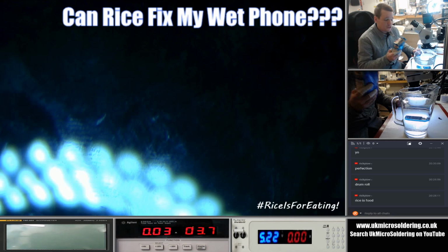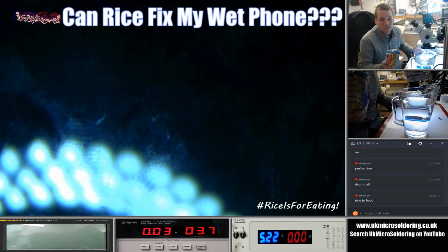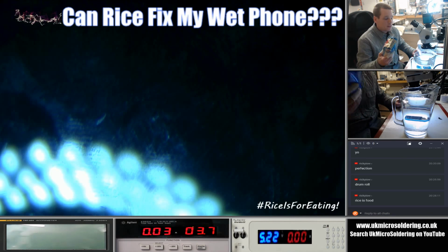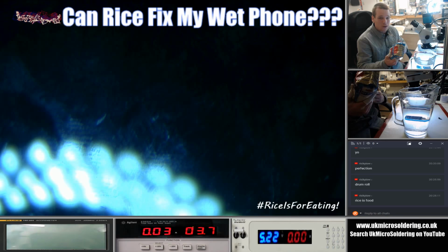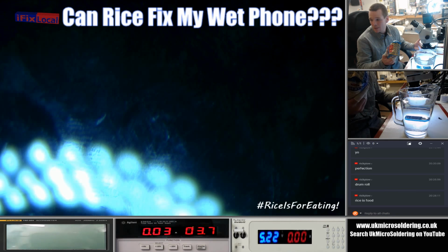The reason I am doing this is because people stick it in rice for a day, 2 days, 3 days, a week, 2 weeks, whatever it takes. The phone's still full of water, and then they go and plug a charger into it, and it annoys the hell out of me because we could have probably saved the data on their phone, probably the phone as well, if we just cleaned it and it was brought to us first. But now it's blown half of the power rails in the phone because it's still wet and you're putting current in it. It's just ridiculous.